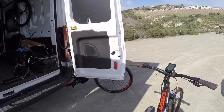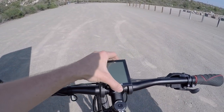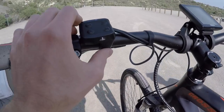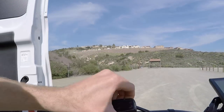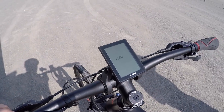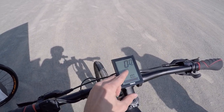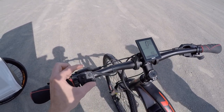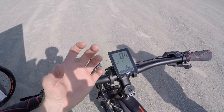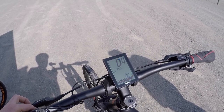I'm going to jump into the display panel now. I love that they've got this remote button pad — really easy to reach and interact with, so you don't have to take your hands off while you're riding. The display panel itself is removable, so you don't have to leave that outside if you're parked at a rack exposed to the elements. Over here on the button pad there's also a micro USB port — this puts out five volts, 500 milliamps. Pretty good setup. We've pressed the power button and the display jumps to life, it's pretty big so it's easy to see, mounted up high. It does swivel a little bit. Got a power meter on the left, clock in the middle, speed in miles per hour. And down here we have battery percentage in addition to a bigger battery infographic. You can change through other readouts by pressing the S button — so now it's saying RPM, pedal RPM.